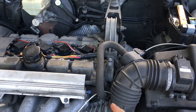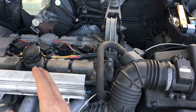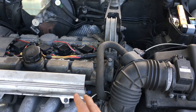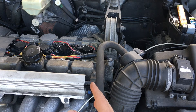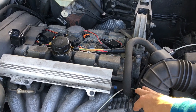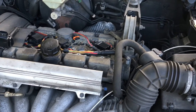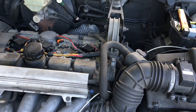Obviously the engine didn't start, but you could hear that the cranking noise was even. So what you're going to see is when we take off one of the spark plugs to create the effect of the cylinder with bad compression, that is what's going to happen. So we'll do that now and we'll come back. As you can see, we've taken off one of the coil packs and completely taken off one of the spark plugs, so there's obviously going to be no compression on that cylinder. We're just going to crank it round again — and hopefully you're going to hear the difference in what it sounds like.